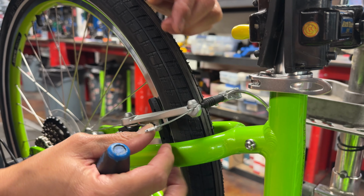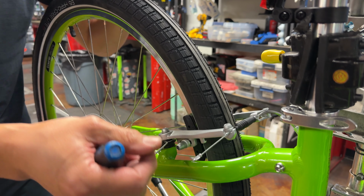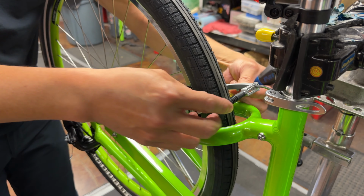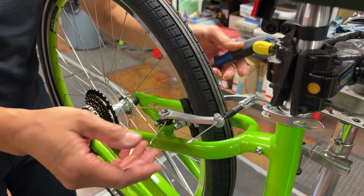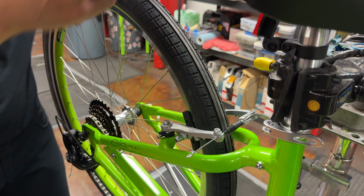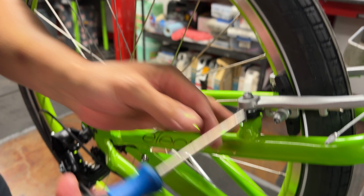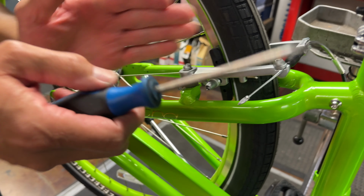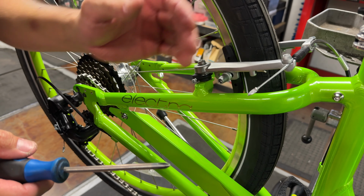Watch your fingers. Sometimes they're under an intense load, and sometimes they snap and smack the top of the nails, and that kills. So you can remove these, and there's two ways to adjust them. If you look at them, I have two screws on both sides here. What that is doing is that screw comes in, and that increases the tension on the spring and pulls it one way or the other.